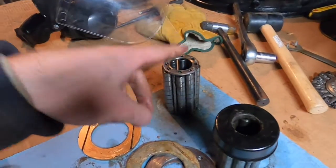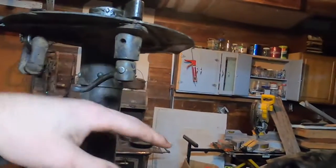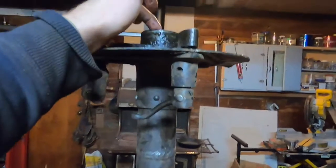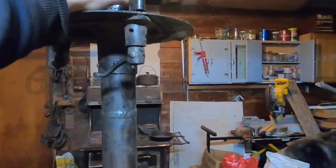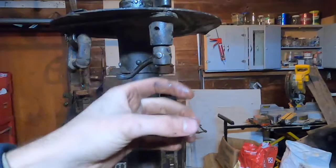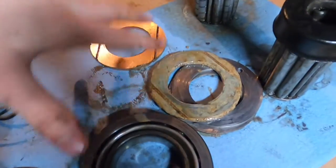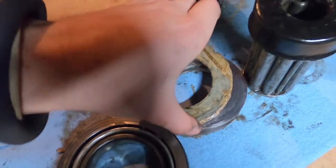I'm going to be putting in a new neoprene seal for the inner seal, pushed from the outside and sealed right there. To change those you have to take out the sleeve on the inside — you need a special tool that I don't have yet. You put the new seal in, replace the sleeve, then the bearing on the inside, and the grease cap on the outside.